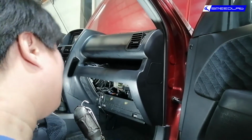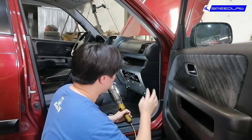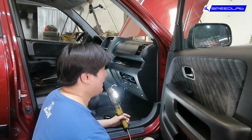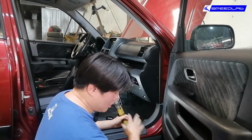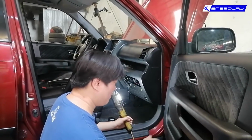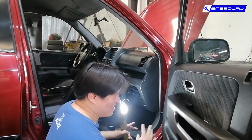If you've seen some of our other videos, you might be wondering why we have the Unichip sometimes, well, most of the time now, in the engine bay instead of inside, where people think that it's less prone to heat. Well, the simple reason is Unichip has to be where the ECU is. And almost all modern cars now, meaning anything from 06 and up, has the ECU in the engine compartment. And don't worry, it's designed to be there.